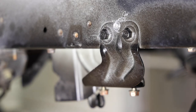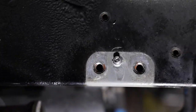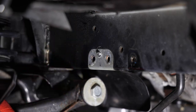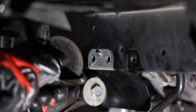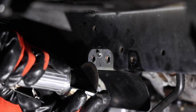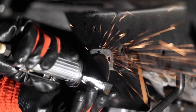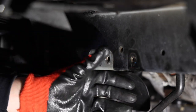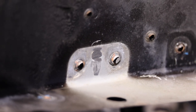Don't get too bent out of shape if it happens — it's fixable. Just to show you the other side for reference, I already took the bracket off on this side. You can see the drill did walk away from me just once, but overall it came out pretty good. Very last step: we've got to grind this nice and flush, so I'll take my grinding wheel attached to my air compressor and it should blast right through it. That looks pretty good and flush to me.